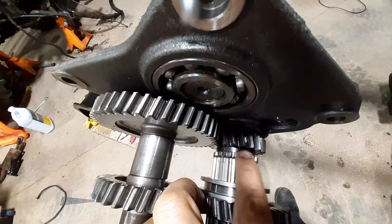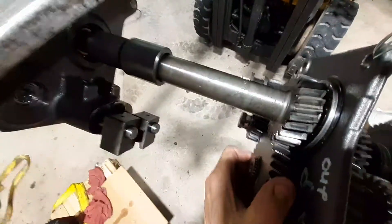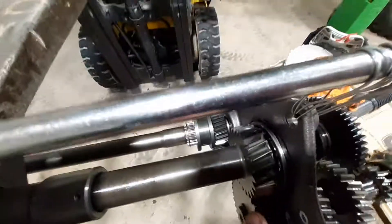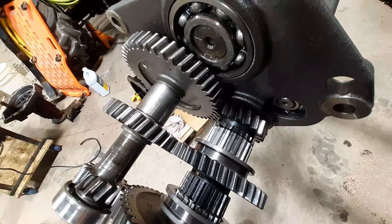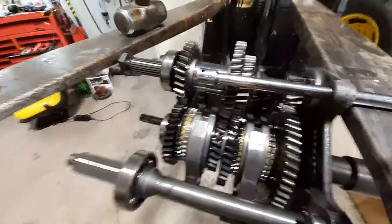Really all we found was debris on here, so it chewed something up and it got jammed. The only other thing we could actually find — if I rotate it — is this chipped tooth right here on this gear, you can see that right there. So if that broke, it would fall on this side of the transmission. It's kind of hard to believe that it sucked that up, chewed it up, and jammed it. Apparently he can only drive it in low range — those are the only things I can really find. It shifts, it moves, it rotates.